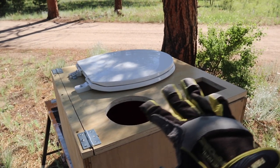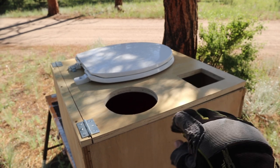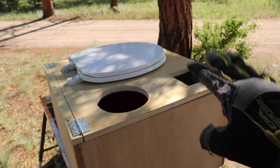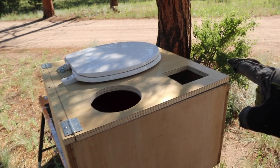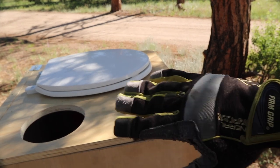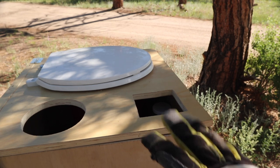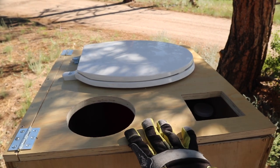I think I'm going to rebuild the entire top of this and change the orientation 90 degrees, so when it slides out I'm going to be seated facing the front of the step van. Right now I'm facing the other shelving unit and the space in front for my legs and feet is sort of limited. If I rotate it 90 degrees, I'll be facing the aisle way towards the kitchen area, which I think will be much better. To do that, I need to remove this top piece here.